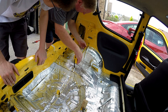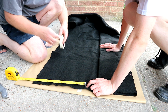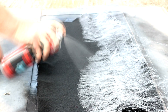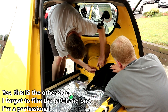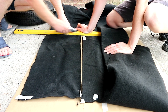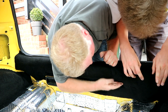Next, it's time to carpet those rear arches to match the rear seat delete. After measuring roughly the size of the arch itself, we then translate the dimensions to carpet. I'm using specific campervan carpet this time, which is designed to stretch over complex shapes and is better suited to covering curvy wheel arches. After cutting the rough shape, we check the fitment and remove any trim or brackets getting in the way. With the outline masked out, spray adhesive gets applied to the arch and the underside of the carpet before the two get pressed together. We start at the back and stretch the carpet forwards, carefully pressing down into all the curves and shapes. With the glue drying we work relatively quickly, until it's stretched into place and cut neatly to fit. With the arches done, it's time to carpet the back of the boot — cutting two rectangular sections of carpet to size, spraying adhesive, shaping them together and trimming neatly. We tuck the boot rubber over the edge of the carpet to make the finish as neat as possible. You'll see the final result later, but already it looks awesome.